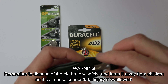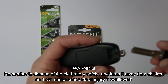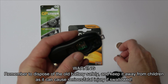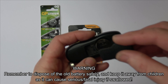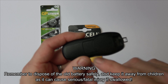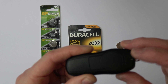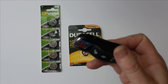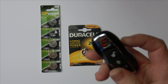One more time — this is the old battery, this is the new battery that I've put in. So take that out like so, put it in here, lever it up, take the battery out, put it in negative side down positive side up. You can clean in here if you need it and then put it in there like so. If you are cleaning in there make sure you do it very quickly — I don't know if you do or do not need to send it to Porsche if it's been unplugged for five or ten minutes, but if you know the answer you can put it down below.